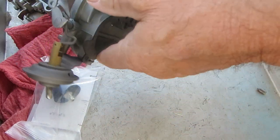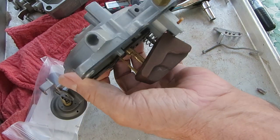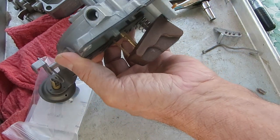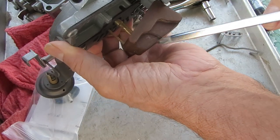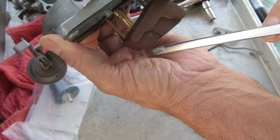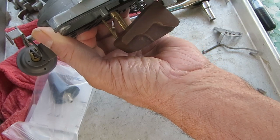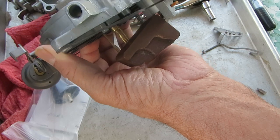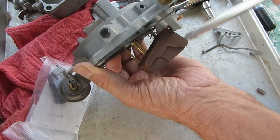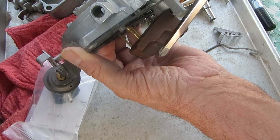Float drop — turn it right side up. And this time you're looking at this bottom edge here — actually the bottom of the float here — and it needs to be level with this edge here. And I can see it's not quite level; it needs to go up just maybe that much.